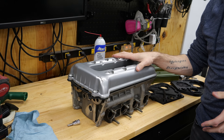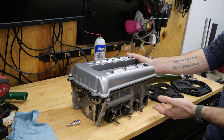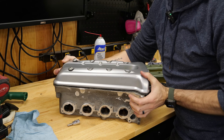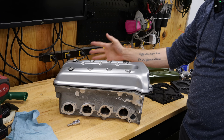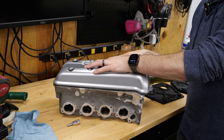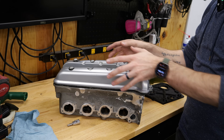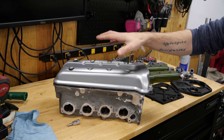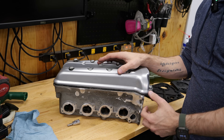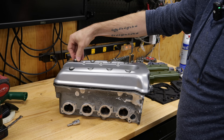The crossflow BMW motorbike head — as you guys can see, it looks a little bit different than an A-series five-port head in that it has holes on the back here as well as holes on the front. The idea here is that this is a fully crossflow cylinder head, meaning air goes in one side and out the other side. Just by the virtue of this being a crossflow head and having 16 valves, it flows almost 40 to 50 percent better than a stock five-port head. The more air you can get into your cylinders, the more fuel you can mix with that, the more combustion you can get, and thus more power.